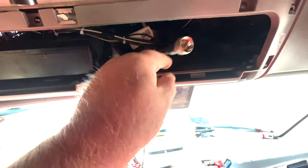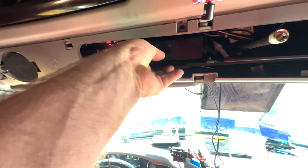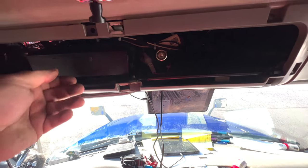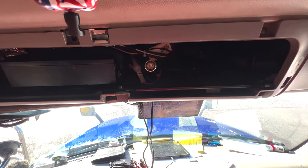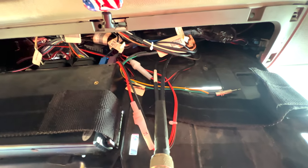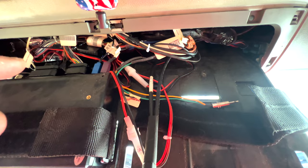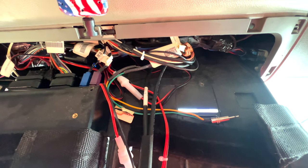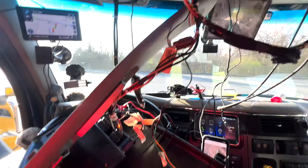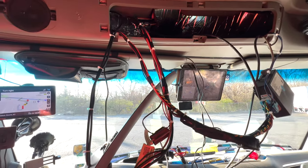This is your coax cable for your CB. You can just pop that tray — lift up on it. You might need two hands for this. Once you pop it loose, pull it out. Once you pull it out, let me show you what it looks like. You're going to want to clean up the wires and straighten them up after you take this plate off.